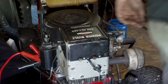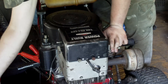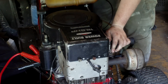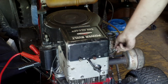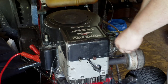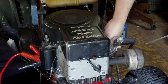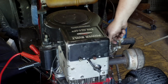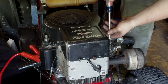Okay guys, here we go — we're going to start it up for the first time since it's been rebuilt. Remember, don't hot rod one of these engines after you rebuild them; you want to get the rings seated in real good. That's in the carburetor here — let me get it adjusted. Let's get 1.5 turns out.